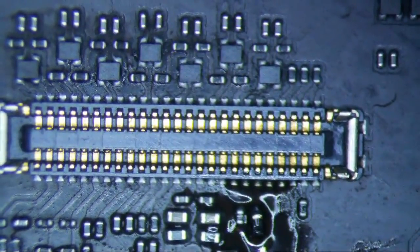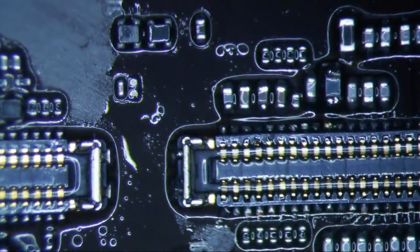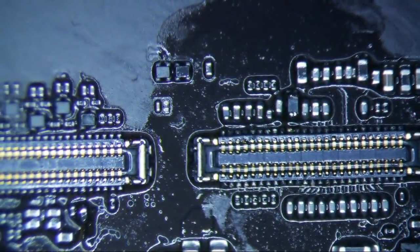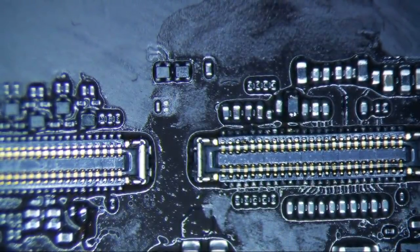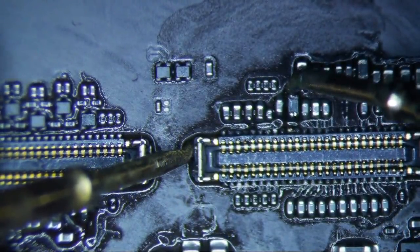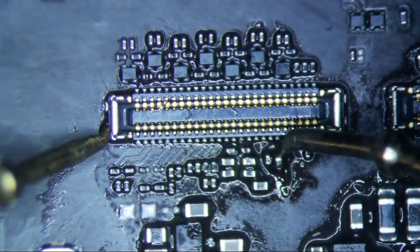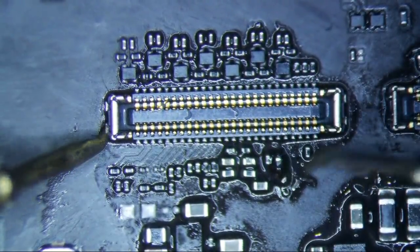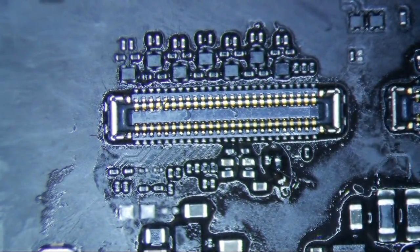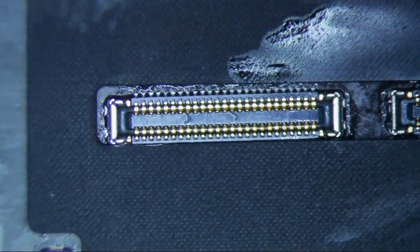Let me clean it up a little bit and then do some quick tests in diode mode. From the first generation values I know the backlight side should be at 0.3 — I'm going to make sure it's 0.3 on both sides, which it is. And this one should be at 0.159 on both sides — 0.159, okay. So we're good to go. Now I'm going to test it and hopefully everything is good. Replace the connector, replace the backlight filter, and replace the touch filter.